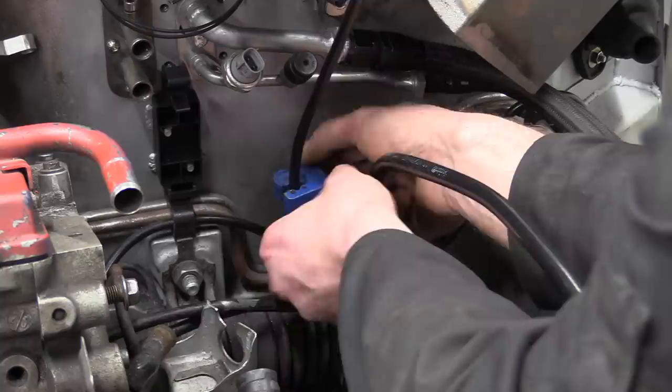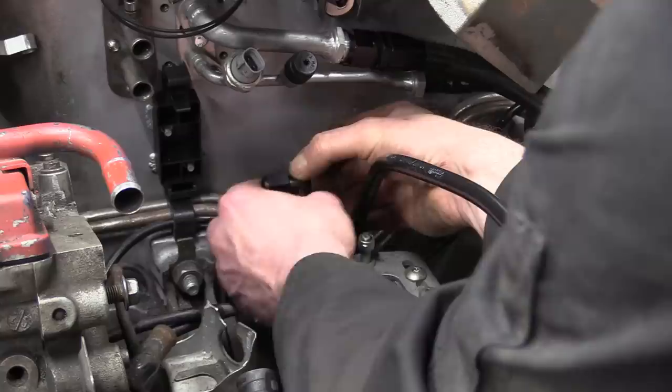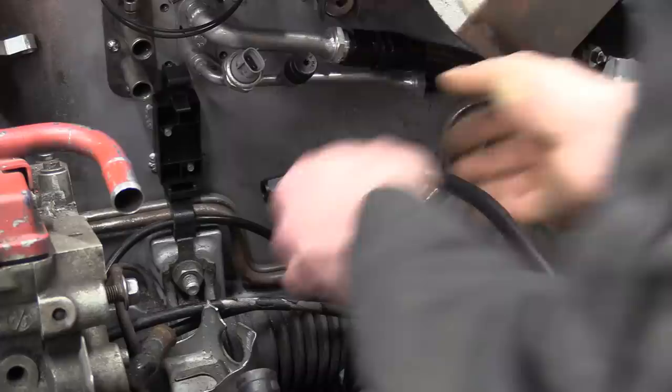While we were down in that area, it seemed like a good opportunity to terminate the fuel system hardlines. The flex fuel sensor is plumbed into the return line, so that's the first one to be finished off with some aluminium dash 6 AN fittings.